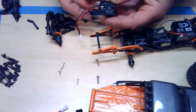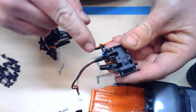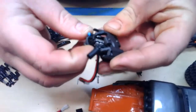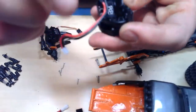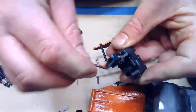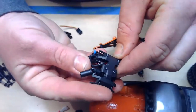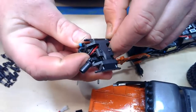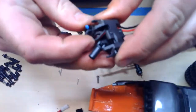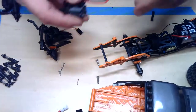So I'm going to do this while it's in here before I put it in the truck. But what I'm going to do with these wires here, so I got these wires hanging out here. These are going to get in the way of that rear link. So what I will do with these, we'll fold them over just like so, being careful not to break anything. Actually, I think I folded them. Yeah, there we go. That'll work. And no, I folded them the wrong way. Or did I? No. Okay. Go like this. Make it a pretzel loop. Go underneath this link here, then fold them. Just like that. Shove those right through the middle here. They go right underneath the motor and point forward. That gets these out of the way of this link mount here. So before you install that, do that.